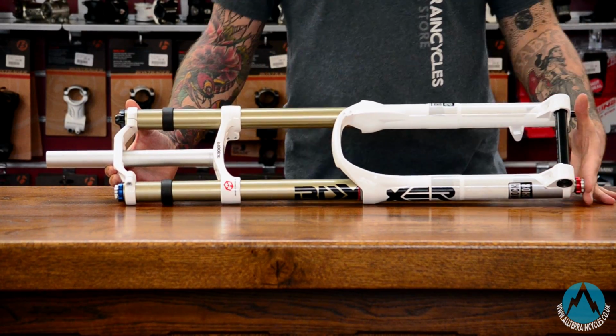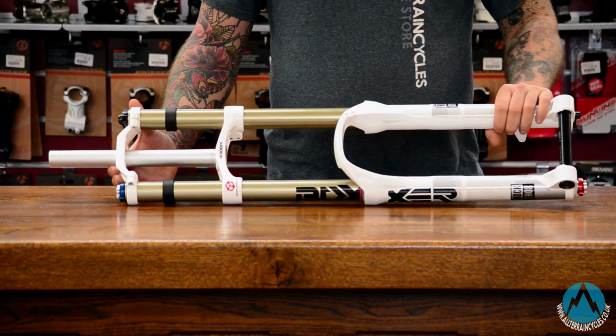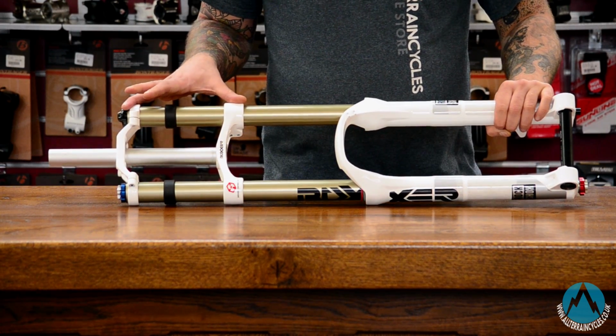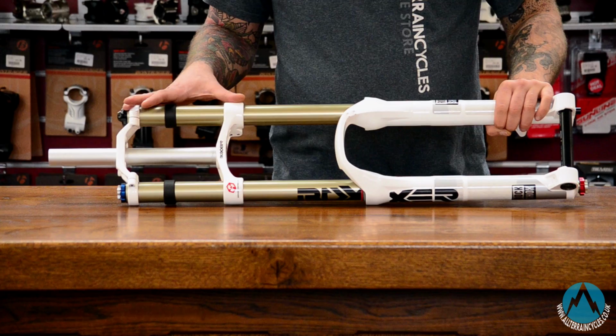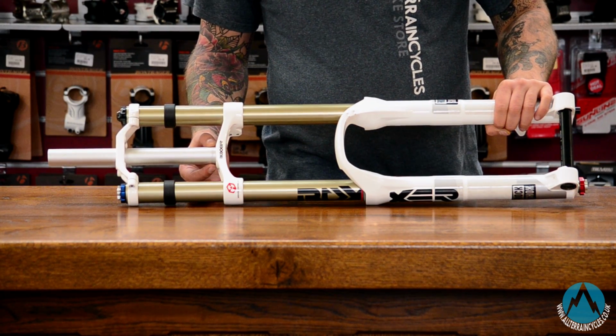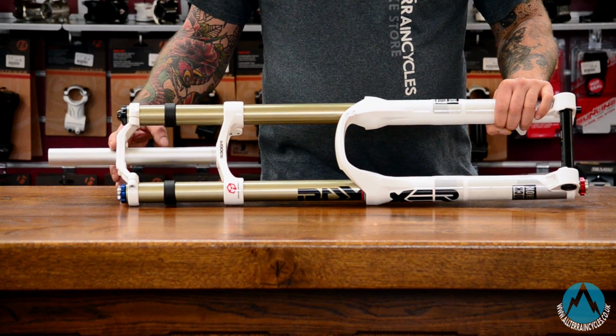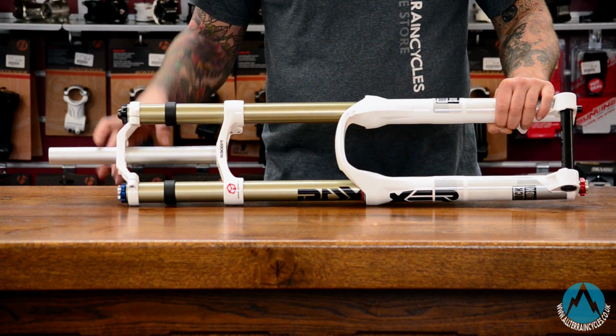The top of the pile, you've got your downhill forks. These tend to be 200mm travel plus. Now also they have a dual crown setup on them rather than a single crown for that added stiffness, so they don't tend to use a tapered steerer on these, standard 1 1/8. They also have a facility to directly bolt the stem to the top crown, thus increasing stiffness.